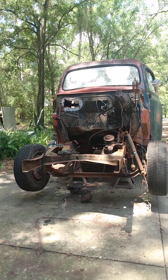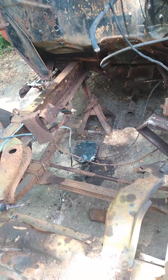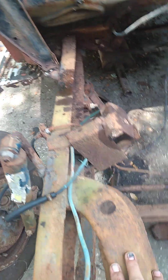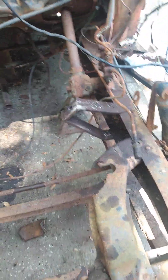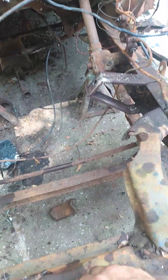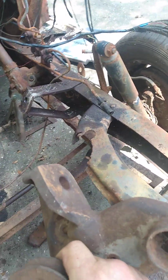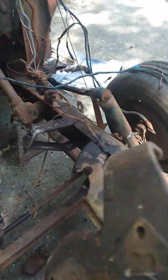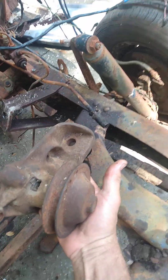I got this old engine out of this. I got the flathead — I pulled the 302 out. We're going to use these original brackets that were made riveted into the chassis when Ford Motor Company built this. This is the Flathead 8 water pump, and this is the mounting. The water pump also has a mounting bracket for the motor mount on the engine. This bolts on to the block, and she sits here — that is your engine support.